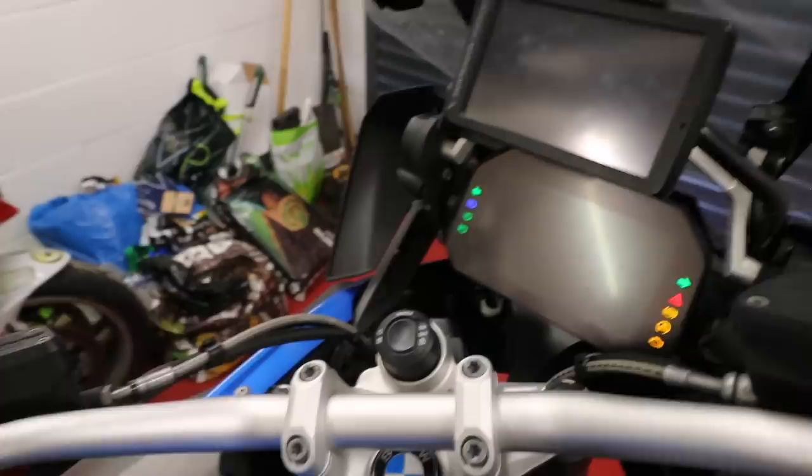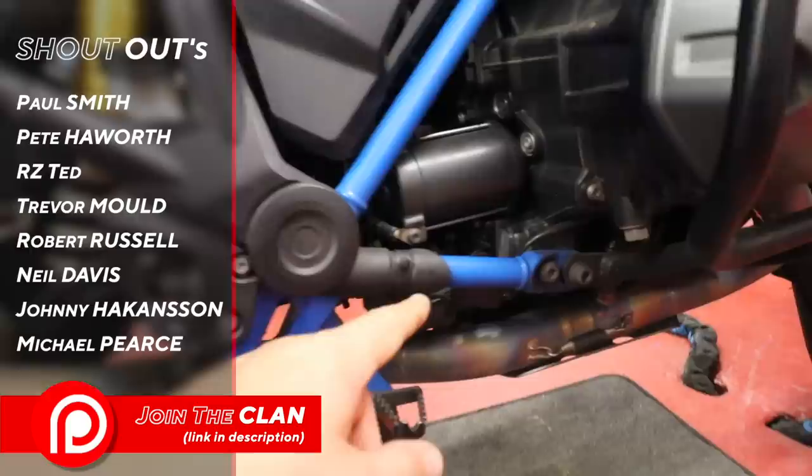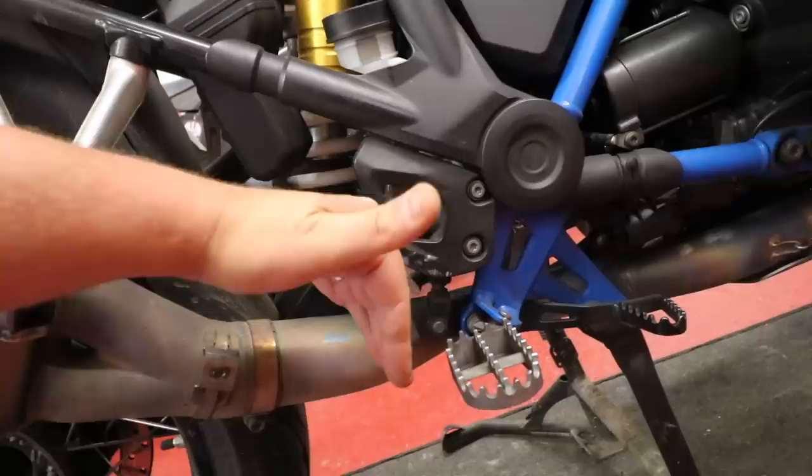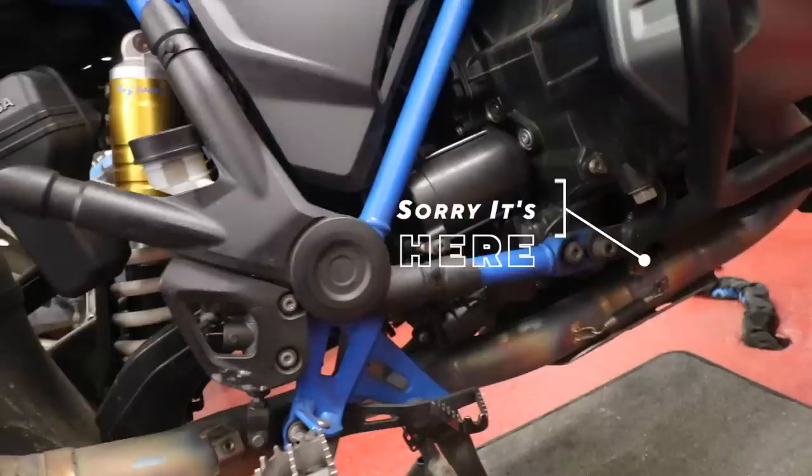Listen to this. That would normally be the ECU priming everything, going through its diagnostics checks. That is this thing, the exhaust servo, and on the full standard system, there is a butterfly valve in there. It moves shut, wide open, shut, and then to a position ready for startup. And that's what that noise normally is that you hear. Obviously on this, it's constantly doing it at the moment because the servo's pooped itself.